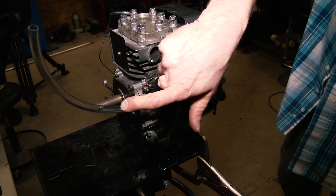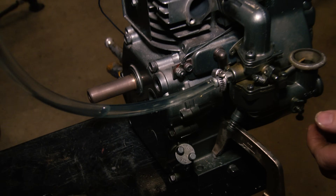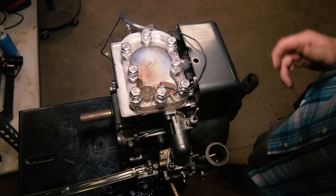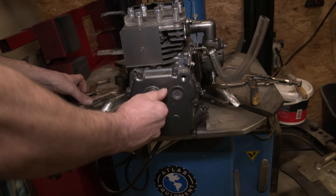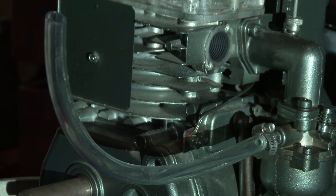Look inside the cylinder. The first fuel we're going to go with is the safest fuel — good old fashioned gasoline. The difference from the last time we ran it is that I've actually adjusted the mixture of the carburetor to make it stoichiometric. No engine really runs a stoichiometric mix — it always varies depending on the load — but we got as close to 14.7 to 1 as we could.